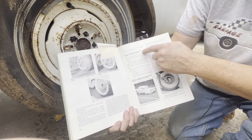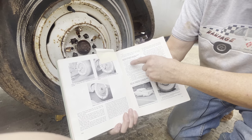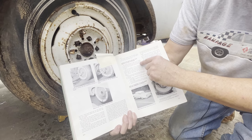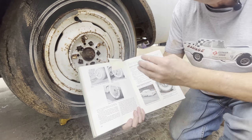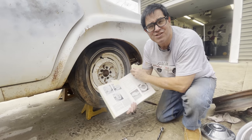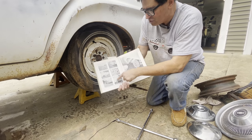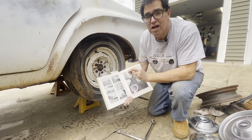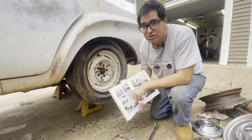It says here: "Wheels with right and left-hand threads on wheel fasteners." Some vehicle manufacturers utilize the safe practice of using right-hand threads on studs and nuts to fasten wheels on the right side of the vehicle and left-hand threads on the left side. It's a fail-safe against mechanics leaving your car with loosely tightened lug nuts. They tested a '57 Chevy four-door where they intentionally allowed the wheel to leave the car, and found that with left-hand lug nuts on the driver's side, the wheel wouldn't come off as soon. So it's a thing, and it's seen on the driver's side of Mopars.